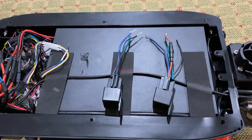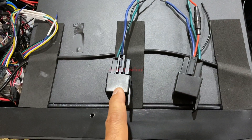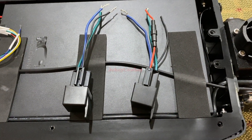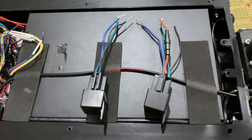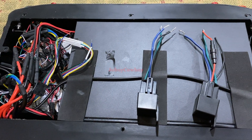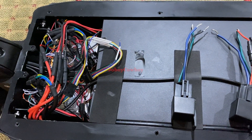At first, I purchased these two small relays — CJ730 and LK720. I tried both devices and I cannot make them work. I saw on YouTube that they work on a motorcycle or a car, but on this scooter I cannot make them work. So I found one new device that works with this scooter, with the Dualtron Thunder, but I'm sure it will also work with any other kind of scooter, as long as you find the right wire coming from your throttle and cut it and connect that device.